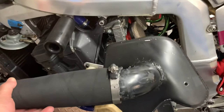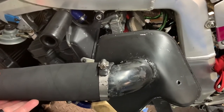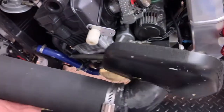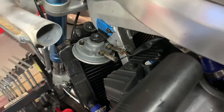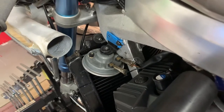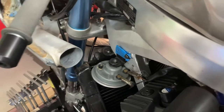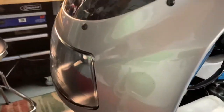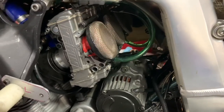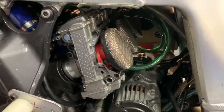Here's my current setup — this is from one of Air Tech's pressurized air boxes that I'm going to modify with some curved PVC. I just cut a hole, stuck it through, epoxied it in, and I'm using that new hose I'm talking about. It's going to go up to where I've modified an OEM fairing. Air Tech makes an air kit and a race fairing, so you can modify and get their kit to work with OEM fronts like I'm doing, and they have a race kit that already has those intakes on there. I'm not running the full air box right now because it's really difficult to get the carburetors on and off, so I'm testing and tuning first.